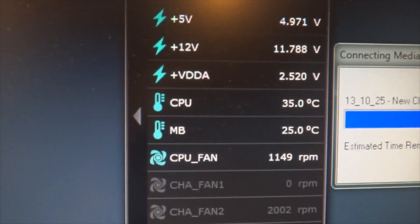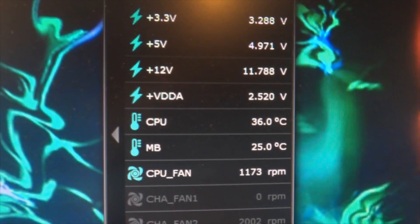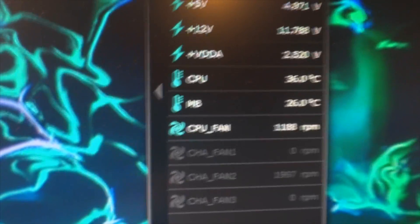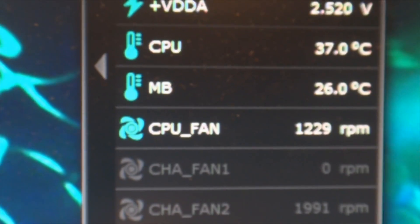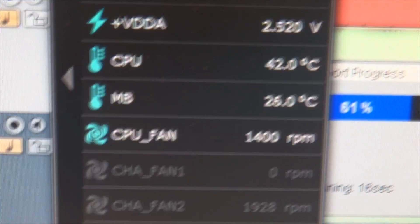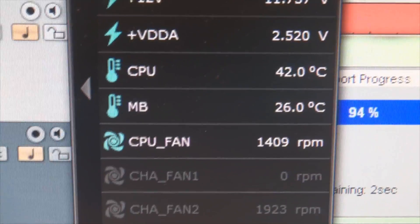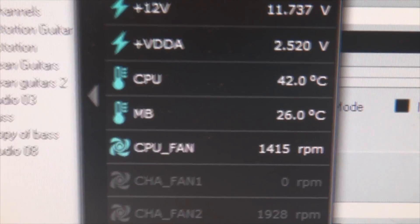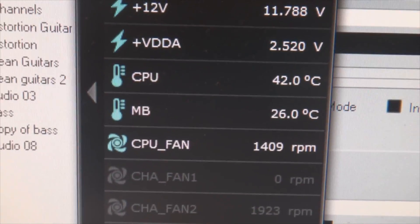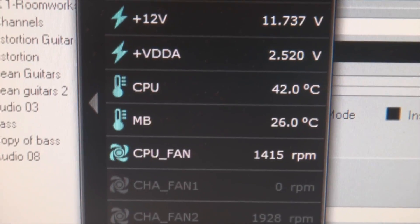There's my fancy case with the LEDs. If you remember earlier in the video, I showed you the temperature with the stock CPU fan rendering a Sony Vegas video for about three minutes — it went up to 65 degrees. Here it is idling for about an hour at 36 degrees. The CPU fan is about 1100 RPM, which is a third of what the stock fan was running at. Once I start rendering in Sony Vegas and mixing in Cubase, the fan speed stays at about 1400 RPM as opposed to 4000, and the temperature stays at about 42 degrees compared to before. My computer has been running for four or five hours, and the temperature with working on this video is about 43 degrees — running audio and video software. So it's pretty amazing. I give it a thumbs up for the Cooler Master 212.